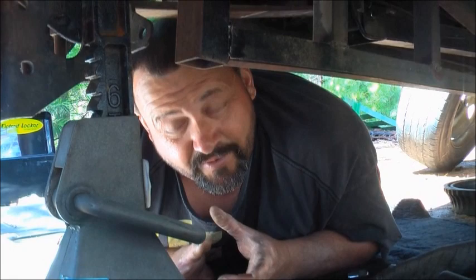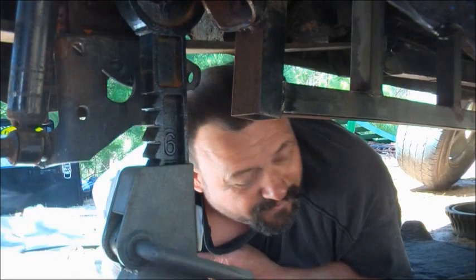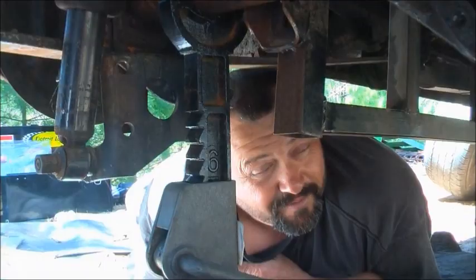Well, the new one's got the new bearing already on it. Oh, does it? Okay. Well, then install, and redo steps 1, 2, 3, and you're done. We don't ever mess with shimming the back half, the pinion part. We kind of do it our way, but it works just fine.